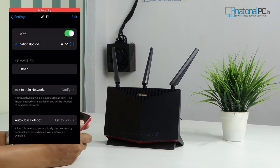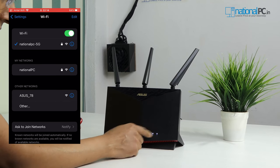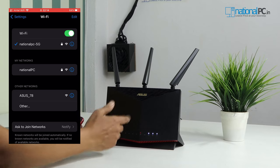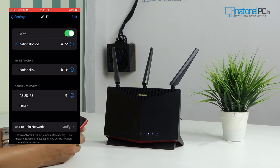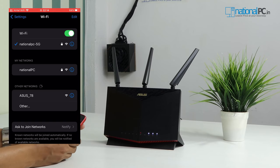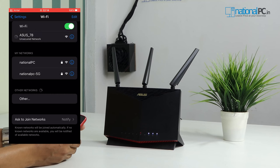Let's check the Wi-Fi signal. The device is now turned on and the Wi-Fi signal is on, but there is no internet connectivity — that's why the internet connectivity LED is glowing red. We will configure this router from the mobile app. First we have to connect to the Wi-Fi signal for this particular router. This is the 'Asus_78' network. There is no password at the beginning, so you can easily connect to the signal.